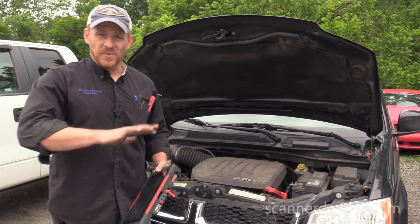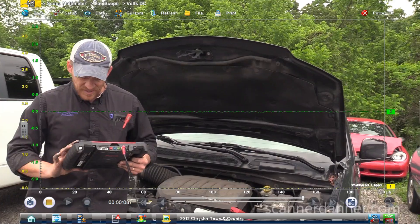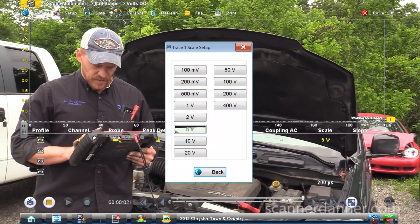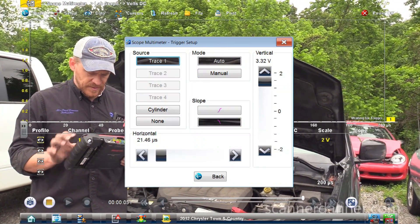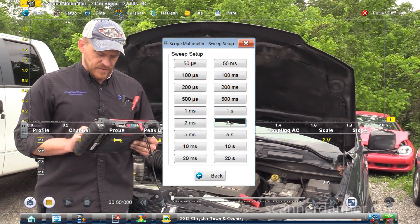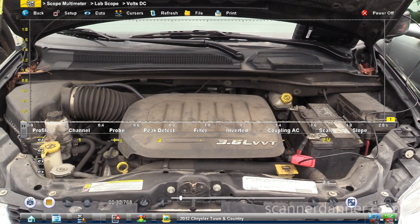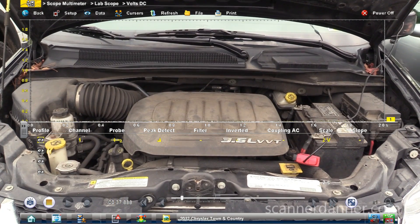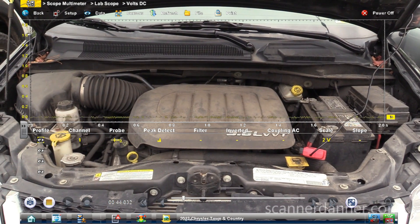I'm going to do this quickly. A lot of you guys already know how to do this test. I'm going to set my scales to a single channel, stay on volts, go two volts. We want to make sure we do not have any trigger setting — let's go no trigger. Two volts, two second screen is my typical setup. I'm having trouble seeing my screen — let's invert that in case I got it backwards. This is one of the reasons you want to pull your zero line up off the bottom.